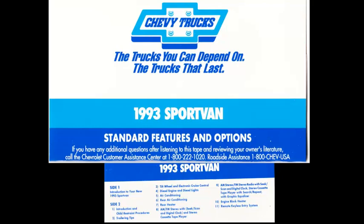Diesel engine and diesel lights. If you purchased the optional diesel engine, there are special fuel requirements, starting and maintenance procedures, and indicator lights of which you should be aware. Your vehicle is designed to use either number 1D or 2D diesel fuel — use 2D fuel whenever possible. During temperatures less than 20 degrees Fahrenheit, use 1D fuel or a winterized 2D fuel. On your instrument panel, you'll find three lights for your diesel engine: the glow plugs, water in fuel, and low coolant indicators. When the glow plugs light is illuminated, you must wait to start the diesel engine — when this light goes out, the engine can be started. The water in fuel light warns you of excessive water in the fuel system. If the low coolant light illuminates while driving, you should have the radiator coolant level checked.